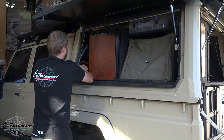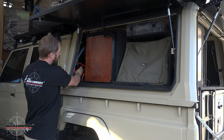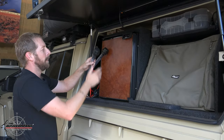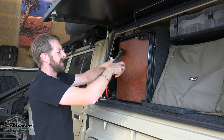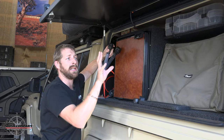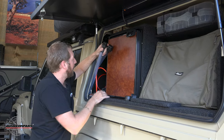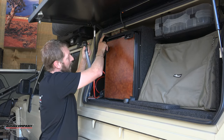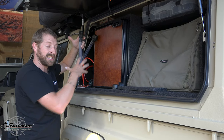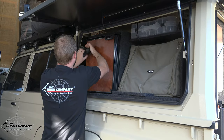The airline tucks away neatly up there. My inverter is attached to the side - easy to plug in and charge GoPros and cameras. For the filler caps I've used clear piping - I can easily undo them, push a hose down at home, and fill up the tanks. The clear pipes also give a visual aid of water level on top of the electronic monitoring - I can see when the tanks are full from the pipes pushing back up. Additional breather lines run through the back wall and out the top to allow the tanks to breathe when filling, so the tank doesn't expand and pop.